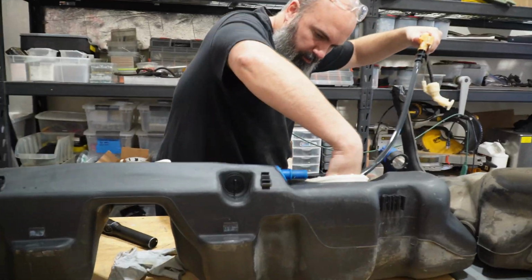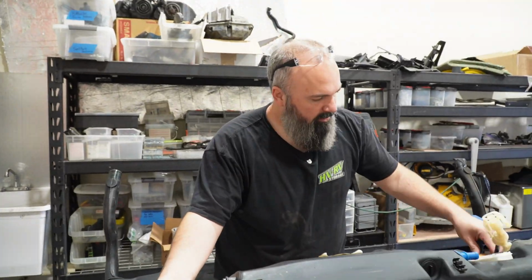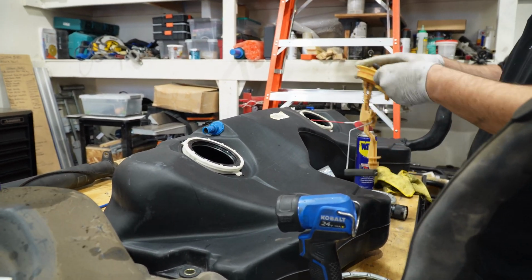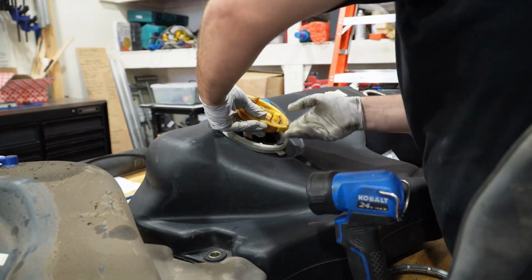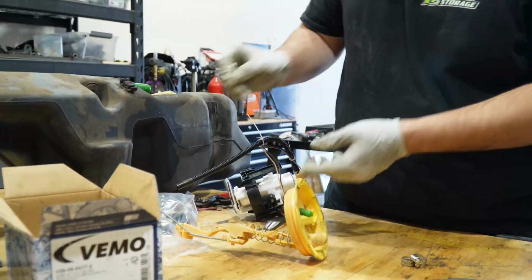And on the pump side, it has to plug into the little pump basket, and the passenger side plugs back in to the top of our housing. That's where it creates that pressure and suction, push fuel back over and into the basket. To prep our fuel pump, we're going to plug in our wires there on the top. There's a big and a little one. You can't mess this up.